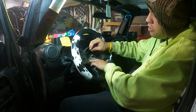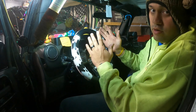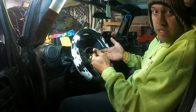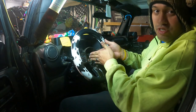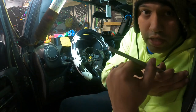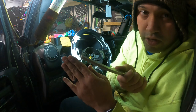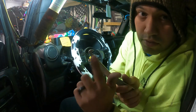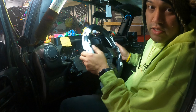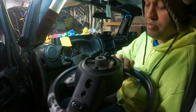You put the steering wheel puller in these two holes. It was kind of hard to do with the camera — I needed a lot of room and hands, so I didn't record it. You press the center, hook these two hooks. It wanted to walk in, so I actually stuck two wrenches on the inside of the puller so the hooks wouldn't pull out — to keep them pressed against the outside. You'll need a steering wheel puller with hooks that fit in those two holes. Once you get that, you'll be able to take the steering wheel straight off. There's really nothing hooked to it; all those connectors you did before is what basically stops that.